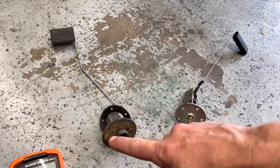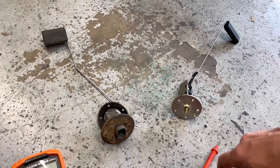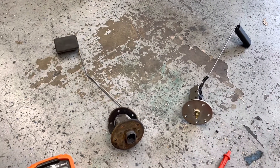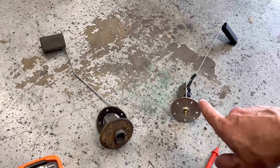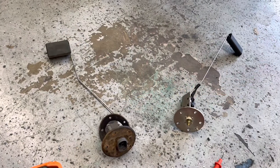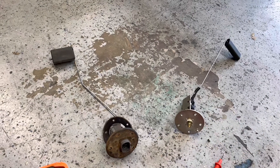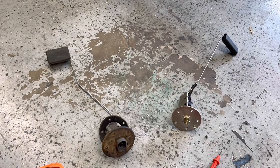I'm going to try to get this fuel sender to work in the RCI fuel cell so that my factory gauge works correctly. If not, it'll be reversed — the E will mean full and full will mean empty. We do have a similar five-bolt pattern, but it's slightly different; they don't line up exactly. And this float is larger than the hole they have for this float. So if I can extend that hole just a little bit without getting a bunch of crap in the tank, and get some holes drilled to where this will line up, it should be pretty nice to have the factory fuel sender in the tank.